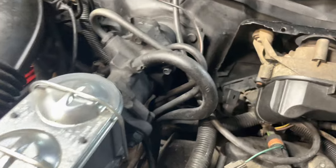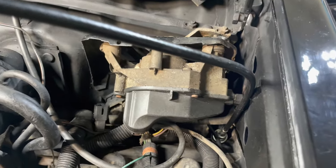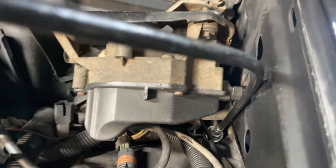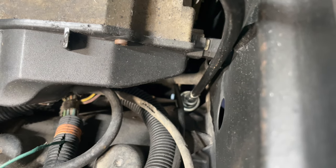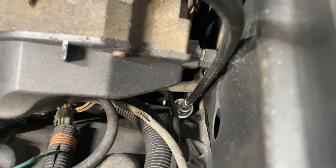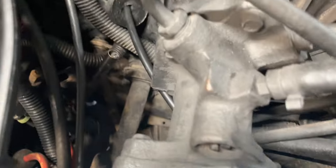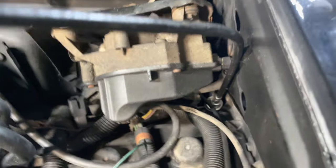Here's a tip if you're trying to get that cable routed from underneath the hood to the frame and the floor: leave a flashlight there and then take a look underneath the hood at all the areas where you see light. Where the cable is in the middle of the screen — that is an opportunity to snake that wire down. You don't want to go over here because that's way too close to the exhaust and the steering column, so you want to stay far to the right of that.